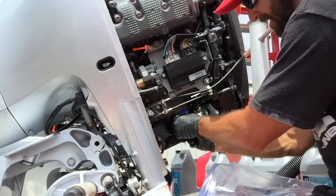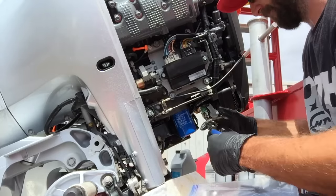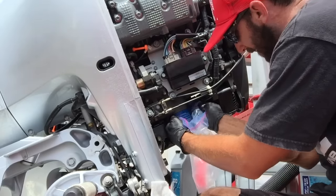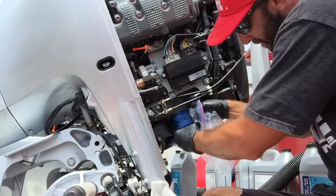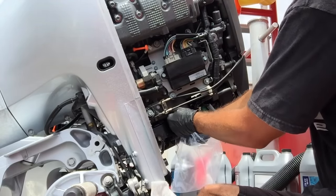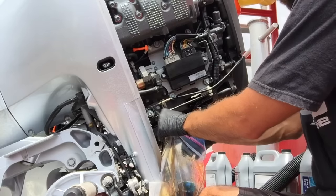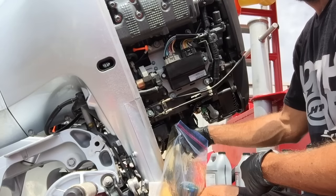I'm going to get out a Ziploc bag and put it all the way around the filter. First I'll see if I can get it undone by hand, but since I've got oil on my gloves it's not going to work. So I'll use my filter wrench to loosen it just a little bit. Now that I can move it by hand, I'm going to put this Ziploc all the way up around the backside — all the way back on the metal. If you don't have skinny fingers it's not easy, but you hold it and start twisting. Most everything ends up in there; just a small cleanup issue.